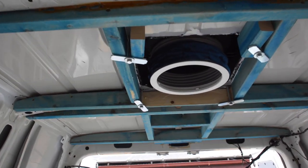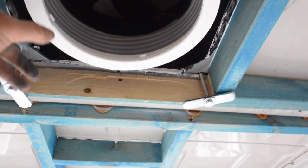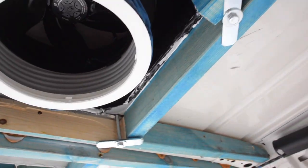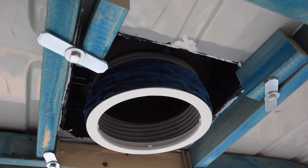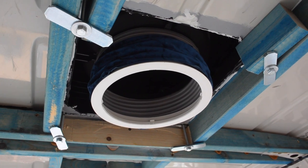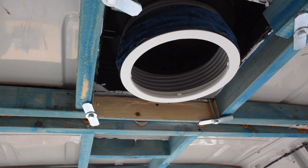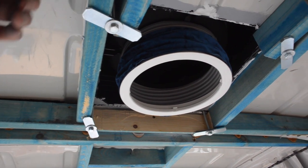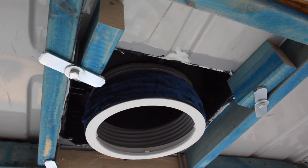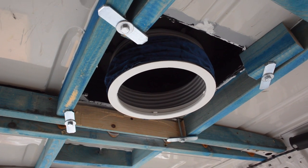All right, so we've got all the wood pretty much done. Problem is this aircon only does a 70mm thick roof, and these are 70, so it's just going to be a bit narrow. So I'll have to maybe get a thick roof kit for the aircon. See how we go. It's going to be tight. Oh, no, it won't, because we've got a 10mm board on top of that for the ceiling. So anyway, beautiful.